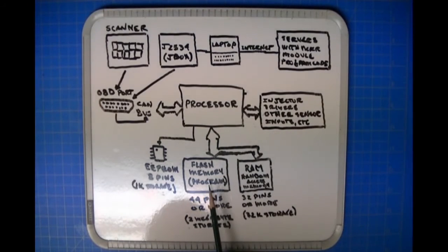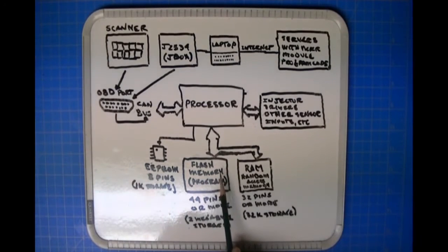This running program will erase part of the memory. This is a flash memory part, and as I said previously, the memory is organized into what are called sectors. So it goes in and erases all of the data currently in the part of the memory which makes the ECU be the ECU. And if you interrupt it at that point, or you do anything that causes any kind of exception to occur, you can brick your module, because it's running a separate program.